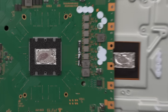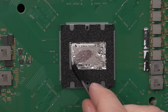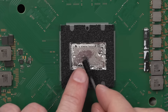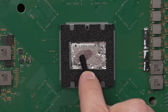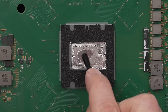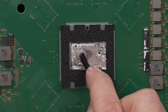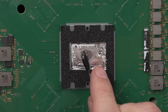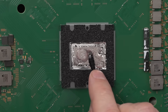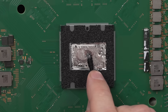One of my favorite ways of taking care of oxidation is just taking this — it looks kind of like a Q-tip, but it's not a Q-tip. I actually like these a lot better than Q-tips. This came in the kit with the liquid metal, and I'll leave a link for the liquid metal I use in the description. I'm just rubbing the top of the APU with this, and as I rub it, it gets a lot more shiny and gets that oxidation off.